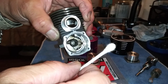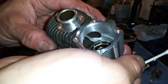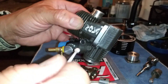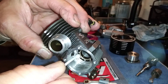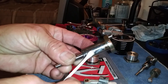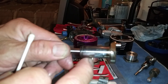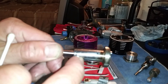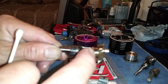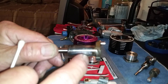If you do that and it's black or dark, you need to pull your motor completely, pull the crank out. I recommend you take your bearings out, clean your engine thoroughly, flush it thoroughly, take the carburetor off and flush it thoroughly. Because if not, that dirt that's in there is eventually gonna wear out and do damage to your crank. You can usually tell if there's dirt in your crank because there'll be scuffs and scratchy abrasions. If you look in this area and see like somebody took sandpaper to it, that means your filter isn't working or you're not cleaning it enough.